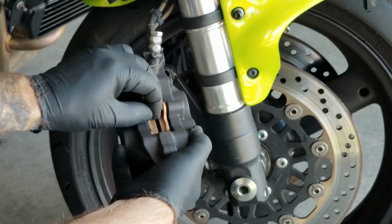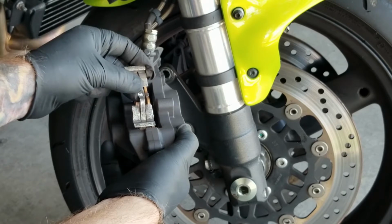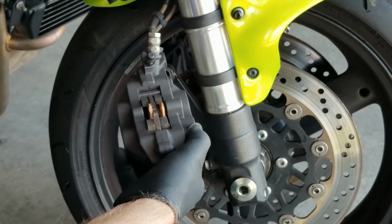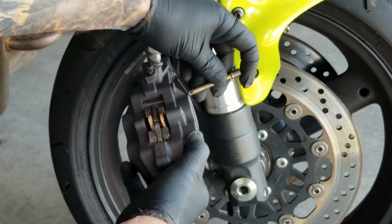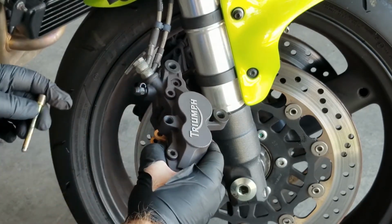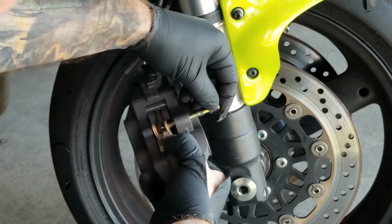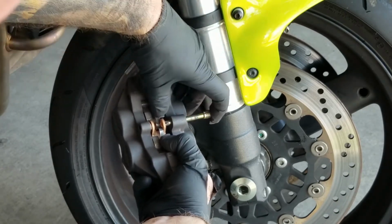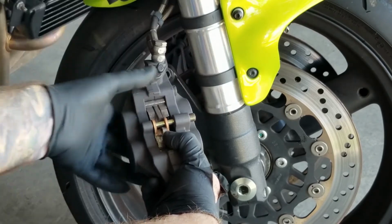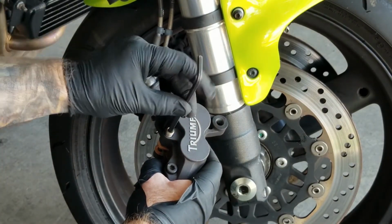And then it's time to grab the spring, lay that down, make sure the stem goes in between the 2 brake pads, and grab the retaining bolt. And we're going to go ahead and put the retaining bolt back in. It helps to put a little bit of tension on the back of the spring. That way the bolt goes through the holes and across the back on top of the brake pad spring. Once you get it all the way in there, go ahead and take your 5mm Allen wrench and tighten that down.